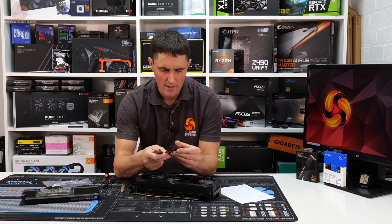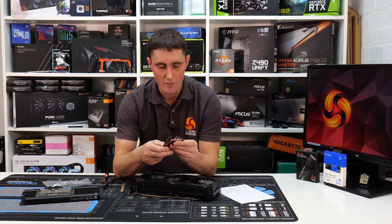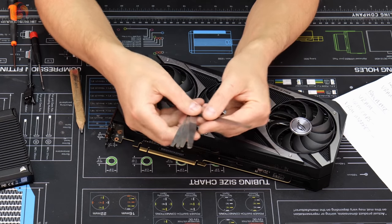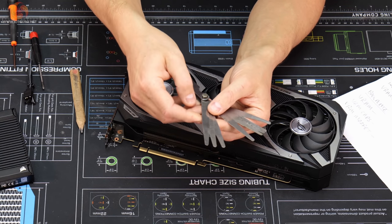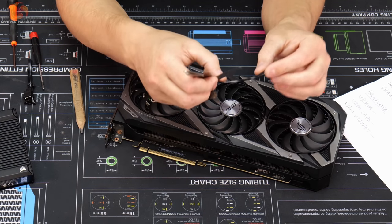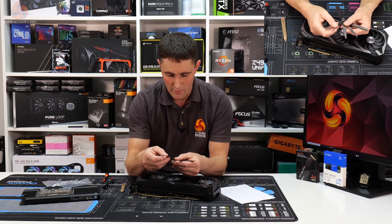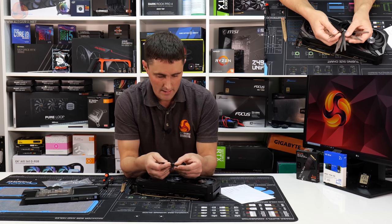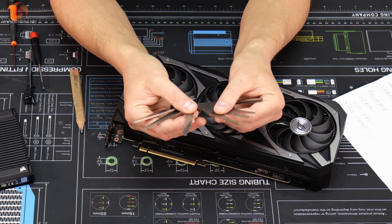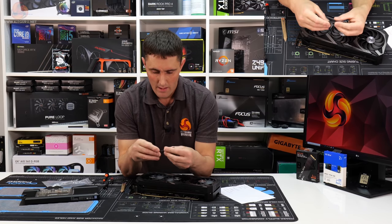I used to set tappet and valve clearances using these feeler gauges, but I don't tend to do that often these days because, you know, hydraulic lifters and everything like that, but I'll not get into that. What these are is they're just basically strips of metal, different thicknesses ranging from 0.8mm to 0.1mm, so that one is really thin. What you can do if you need different sizes that these don't cover, you could put a 0.8 and a 0.2 together to get 1mm, or you could put together a 0.5 and a 0.2 to get 0.7. But yeah, that's what we're going to do.